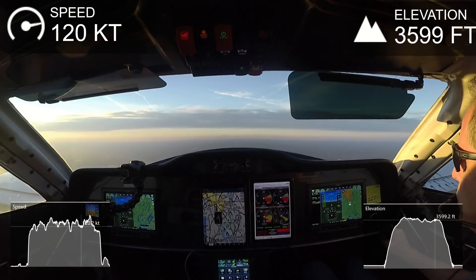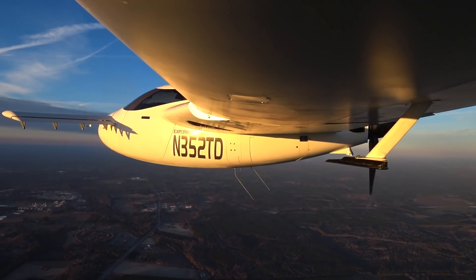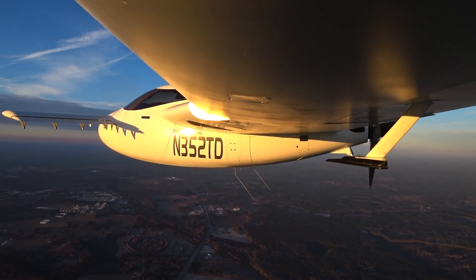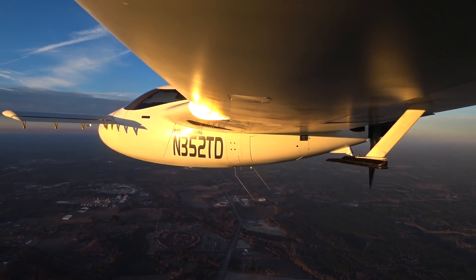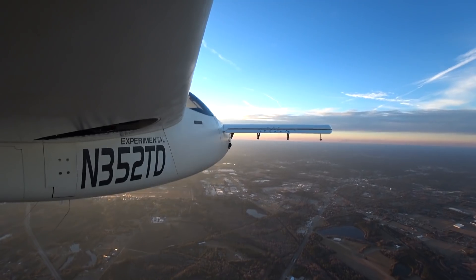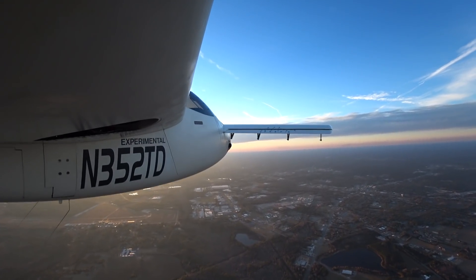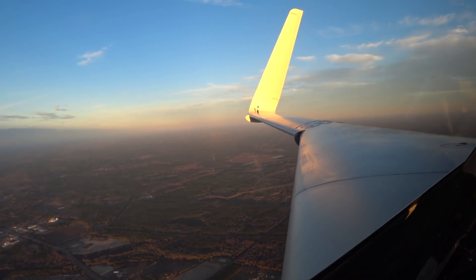I was up about 3,600 feet according to the GPS. I've also made an adjustment to the static port — I made the little fence underneath there a bit larger so it's catching more air and forcing it into the hole under the static port, driving the pressure up a little, which gives me a lower altimeter setting and also lowers the airspeed indication. I think I'm heading in the right direction; it's just a case of dialing in the right amount of forced pressure.